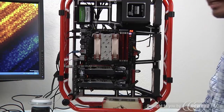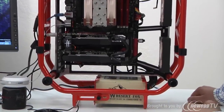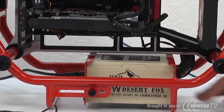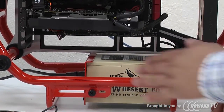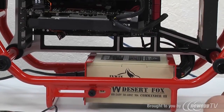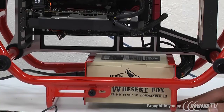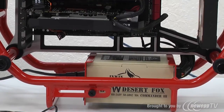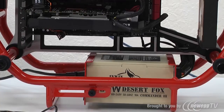In terms of power, we've worked with In-Win and we have an 80 Plus Gold PSU — specifically their 800-watt Desert Fox PSU. Not only does it come in this interesting beige or camo fatigued color, it's also high performance, high efficiency, very quiet in operation, and modular-based. It supports two-way and even three-way SLI configurations. While we're only focusing on single and two-card configurations, there's more than enough power to take care of everything including the overclock for our system.